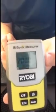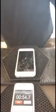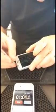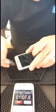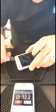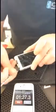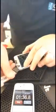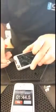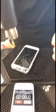$200. Right here I'm just going right at the top of the glass. This is just black adhesive. Nothing to really worry about. I'm not worried about if the adhesive stays or goes. Really the only thing I'm concerned about is getting the glass off. Temperature on these fluctuates quickly. Just remember, you want it about 180.